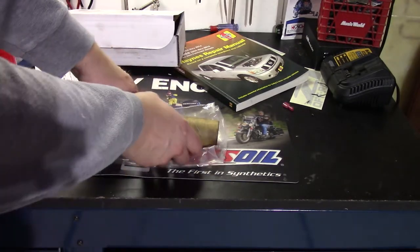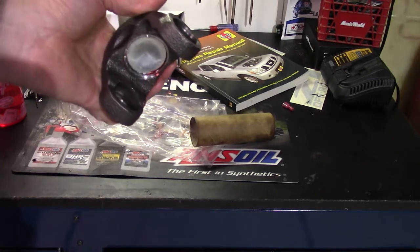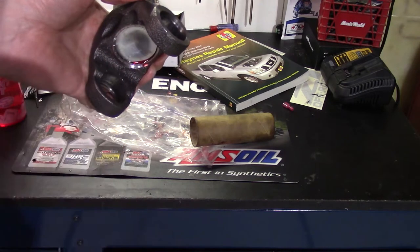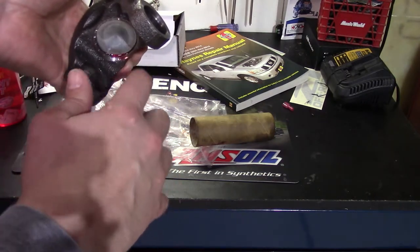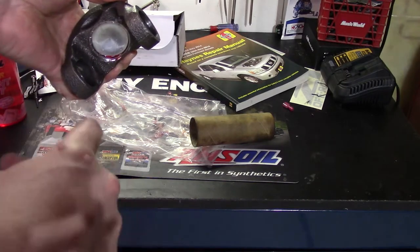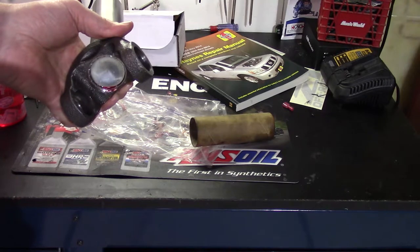How I fixed it was by replacing the yoke. This is the yoke that came with the new driveshaft I bought, and you can see right around the edge — that's where the leak was. Transmission fluid from the transfer case was coming out onto the u-joint, and as the driveshaft spun it would fling around and coat the bottom of the truck in that spot.